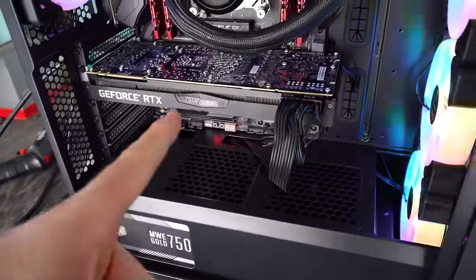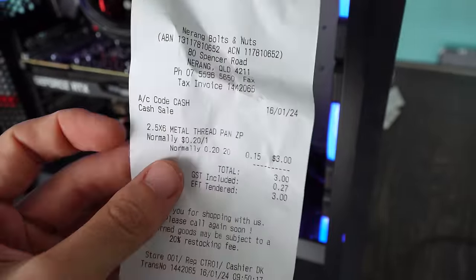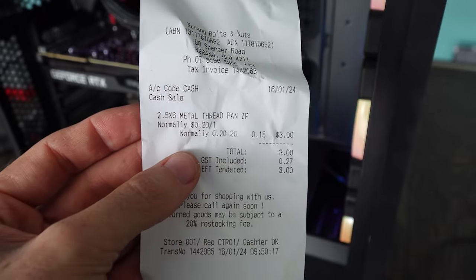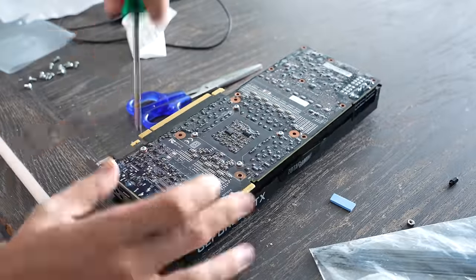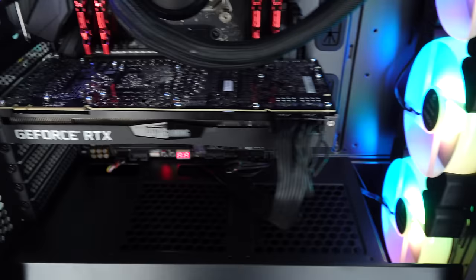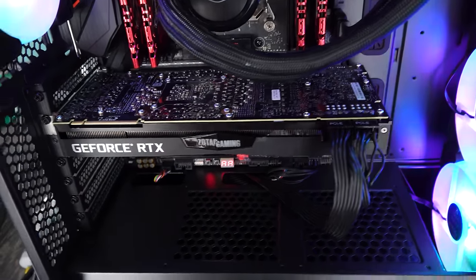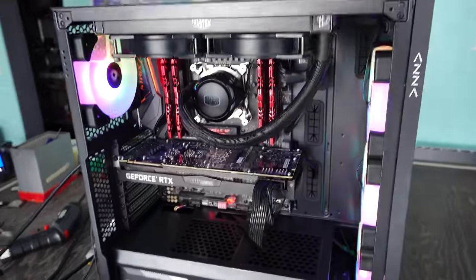It's now the next morning and we have a finished 2080 Ti system. Big shout out to Narang Bolts and Nuts where they measured up the cooler — it was a really weird length: 2.5mm screws by 6mm long. We got 20 of those for $3, an absolute lifesaver. Everything fitted fine, however temperatures are getting a little too hot, so I'm going to run MSI Afterburner and try to undervolt it to around 70 degrees, because the cooler is quite small. With a 2080 Ti reference model they do get around 80 degrees anyway, so I'm going to tune it down — I want the person who buys it to have a long gaming life on their PC.